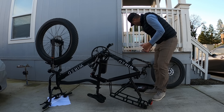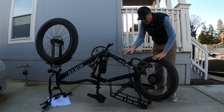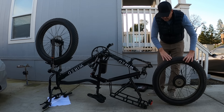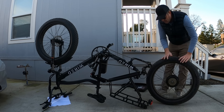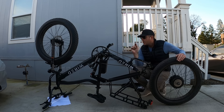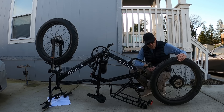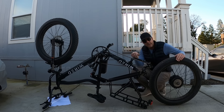We're actually ready to put the wheel back on. I can take the rack off with the bike flipped over later. Also — very important — do not squeeze your brakes while the wheel and rotor are off the fork. With hydraulic brakes, you'll push those pads together and then you won't be able to fit the rotor back in between them. When you buy the bike, there's actually a plastic spacer that goes in between those pads in case the front lever gets hit while the back one's already installed.